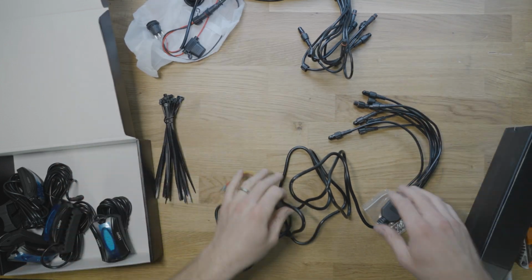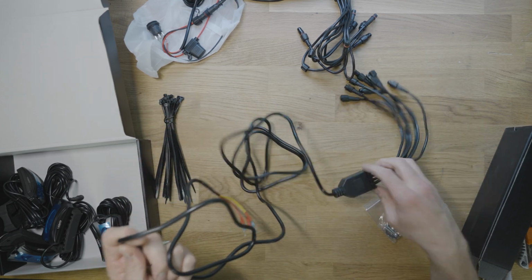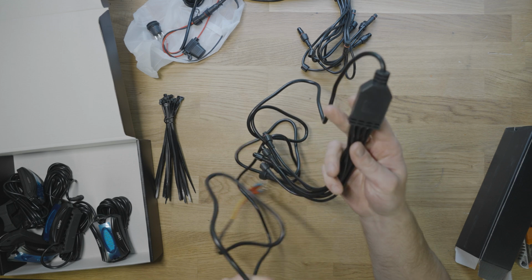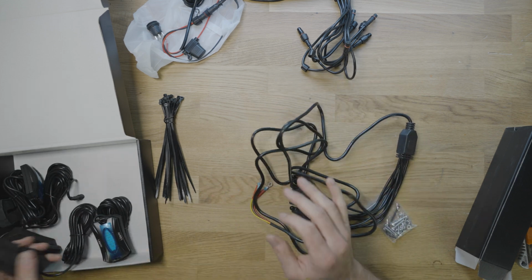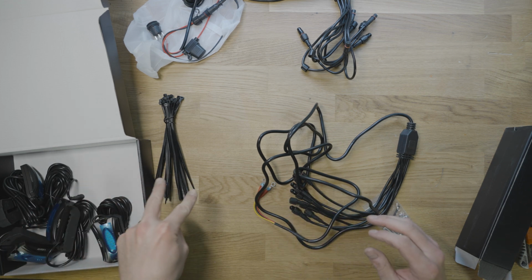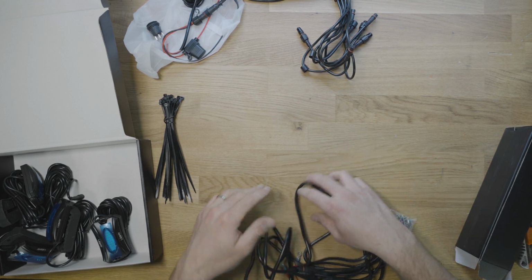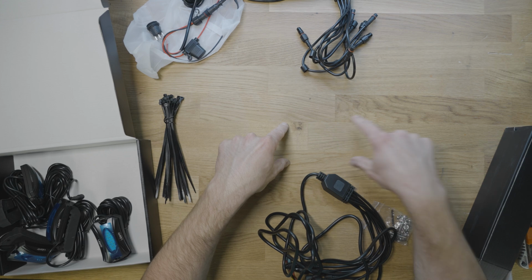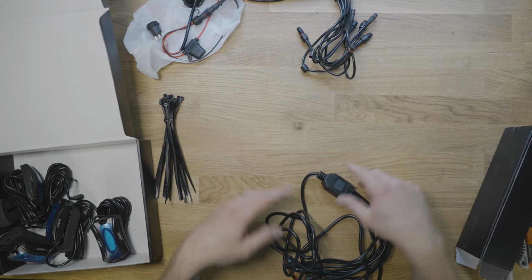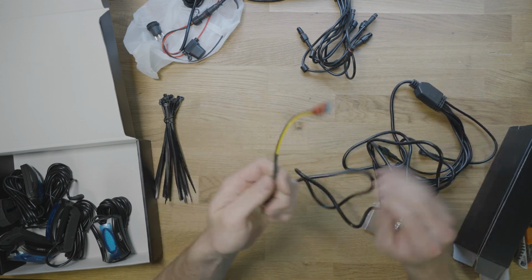My plan is that since this wire is fairly long, this harness can make it down to roughly somewhere in the middle of the vehicle. And then on an 8-light kit, you can use 2 of those fronts, which have shorter wires, to get to the closer lights. So you'll have basically harness, 2 fronts, 2 fronts, 2 behinds, 2 behinds. You should have plenty of length. And then this we will hook up to the switch system.